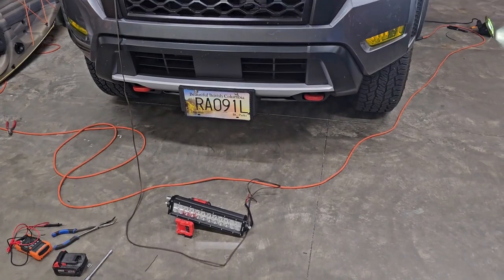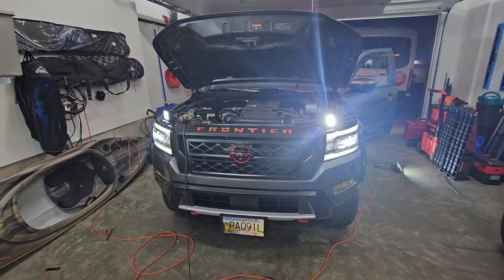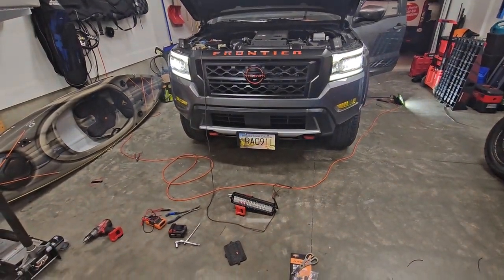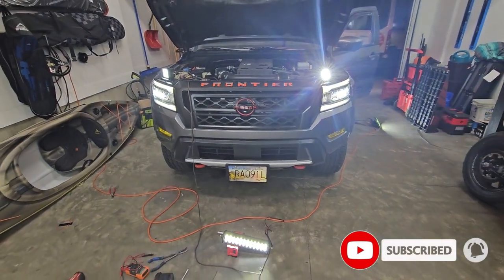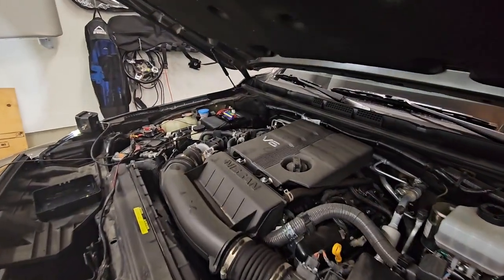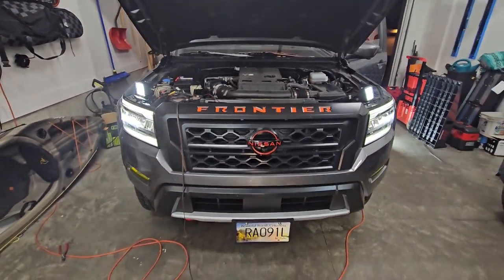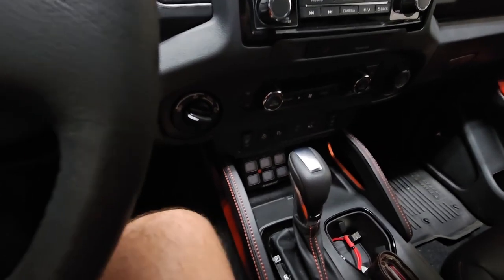We got some lights jerry-rigged here just to show you what's what. If Richard inside hits spot number one — where we plugged in the pod lights — you can see they both turn on. Hit spot number four which was the light bar, and there it comes on. You can turn them both on if you like. There is also an app with this thing where you can do strobe, program what turns on together, or have more than one come on at once using the power switch — but that's enough for a whole other video. For now you can see just how easy it is to use.